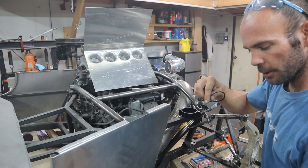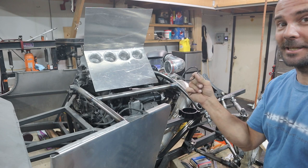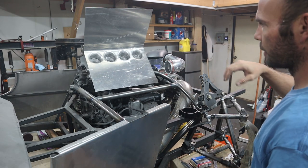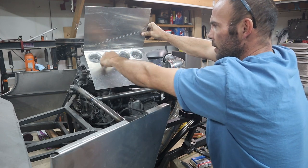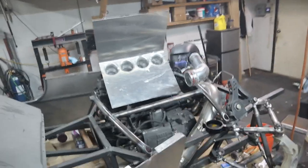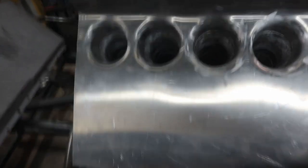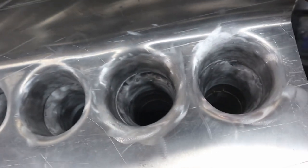The second batch of these clamps that I ordered came with just a black O-ring and they're too stiff — you can slide it together but you damn well can't get it apart. So I ordered some silicone ones and they should be in on Monday. Then I can keep going on the clamps. I might do a little bit of porting to match it up a little better, but it's really not bad inside of there. I think it's sitting close enough, especially for a boosted application.